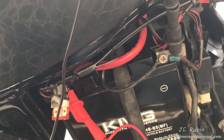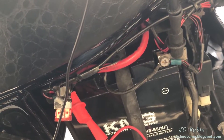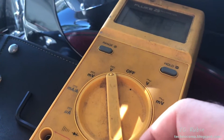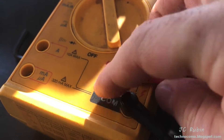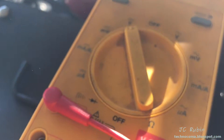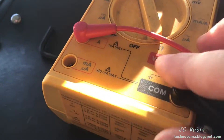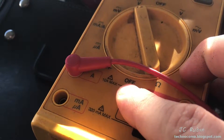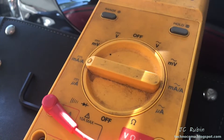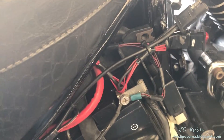Unlike voltage that you read directly across, to do this you have to actually break the circuit. I'm going to disconnect the circuit and put the meter in between. Before we do this, before we cause any calamity - especially on my meter - leave the common probe alone but move the voltage probe. Always start with the one rated for the highest fuse first when you don't know what you're dealing with. Mine happens to be 10 amps, so go to 10 amps and move it to the amp setting.